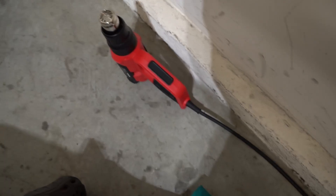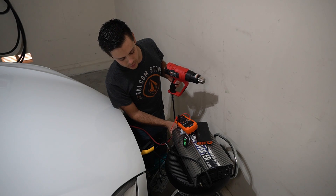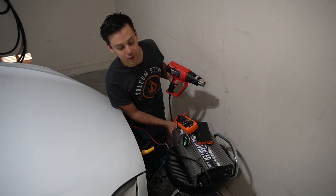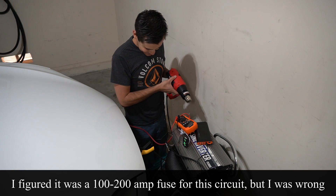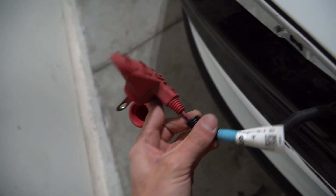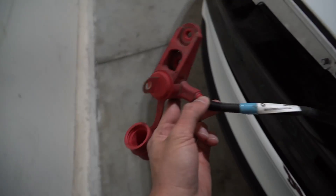Right now we are powering a heat gun — it's super hot. We're pushing 57 amps, now 73 amps at 12.4 volts, and now we're at 12.1 volts pushing 91 amps. Then I realized the wire supplying this terminal stud looks like 12 or maybe 10-gauge wire — there's no way I can use this to extract serious power from the Tesla.